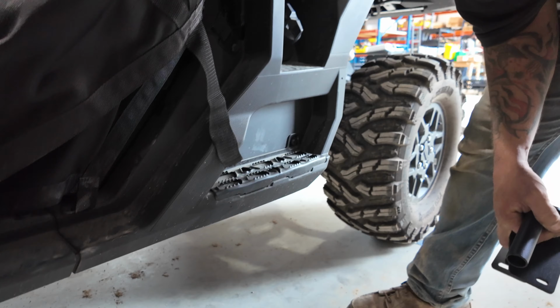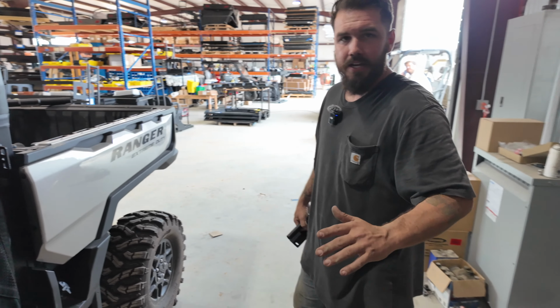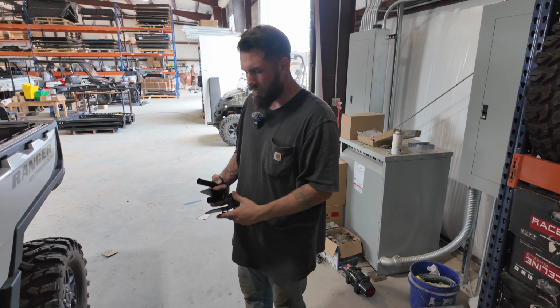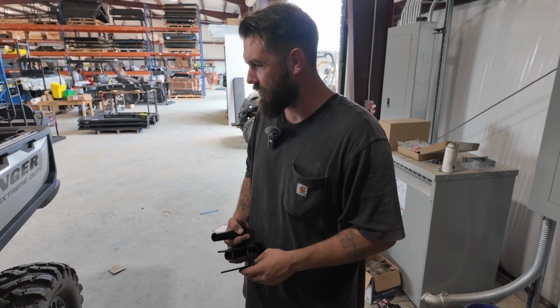So that'd be your rear bracket, and then obviously your front's gonna have this little divot in it to kind of match the contour of the vehicle. And like I said, it's the exact same concept as our crew model. Nothing changes. So obviously you see this side, it's already got the holes drilled. Now if we follow over to this side, I'll kind of just prove to you guys right here. So just like on the crew, there's that divot that you're gonna drill out. Same thing with right back here. Here's that divot that you're gonna punch out. Same thing, hole saw it out, kind of go in as straight as possible and go all the way through. And yeah, it's the same thing, nothing too crazy.